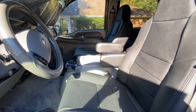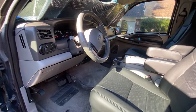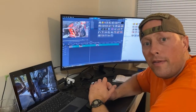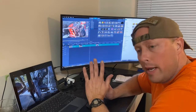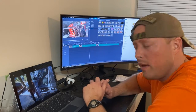It's looking like it's going to be a trip to the dealership to reprogram the key in the Ford passive anti-theft system. That's how this chapter is going to end — unfortunately without an engine running. We'll get it to the dealership, get it reprogrammed. Hopefully that's going to solve all our issues and this thing's going to be up and running.